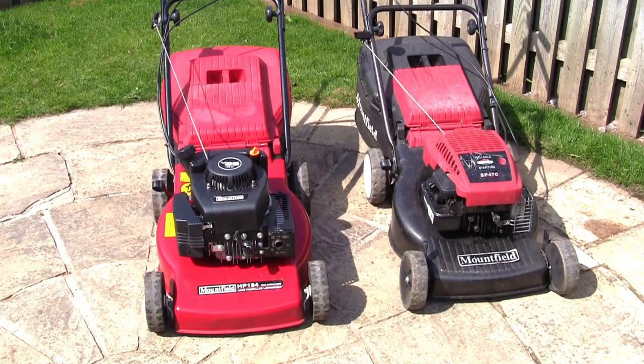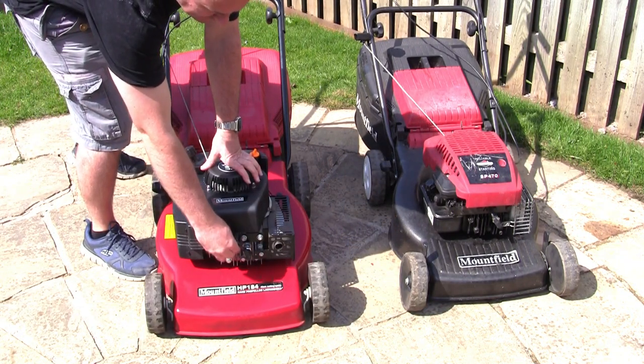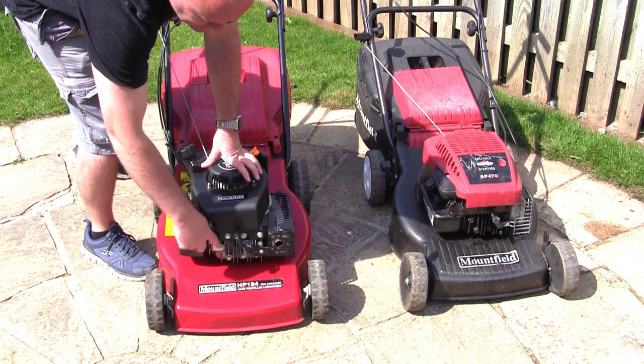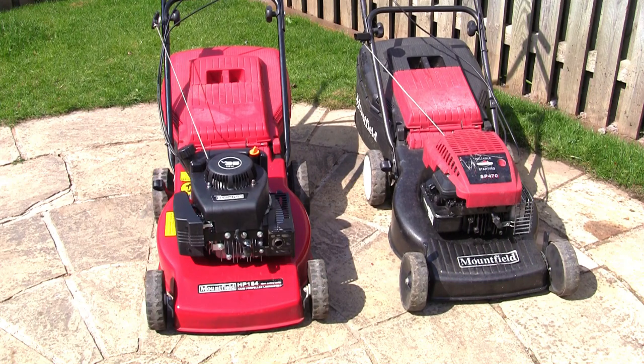So a bit more of an advanced tip, this is if you've got a slightly different style of lawnmower. If you've got a Honda mower or one of the larger engine mowers, you might have overhead valves on the front of here. These occasionally need setting. You'll see a box on the front that says something like OHV. I've actually got videos on how to set those valves, and the reason I'm mentioning that is because if they aren't set correctly, again, you might not have the correct compression, which makes it very difficult to start or very difficult to pull over. And again, I will link in the description to the videos.